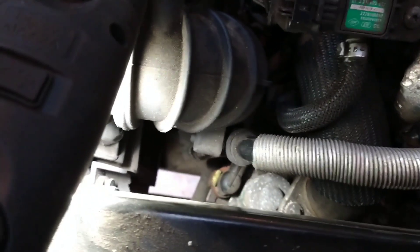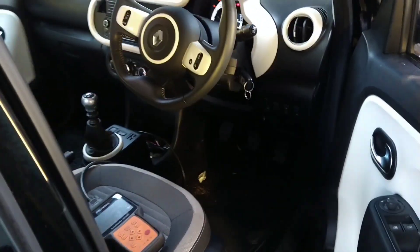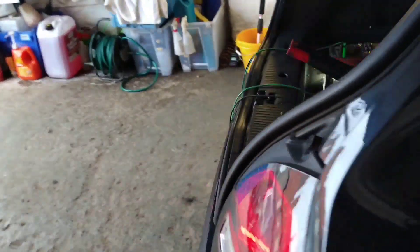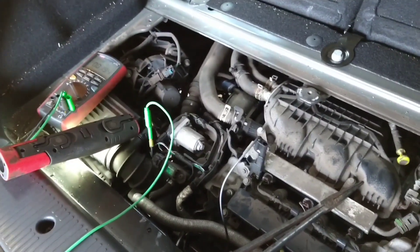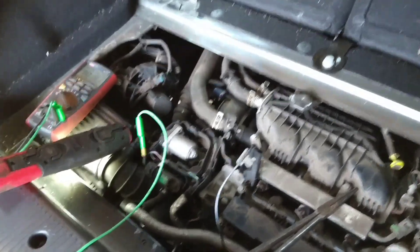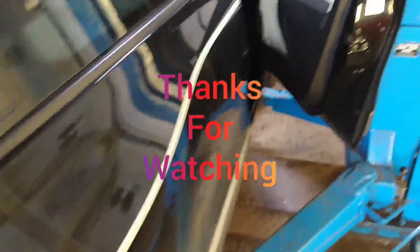Anyway, that's just to show you that when you get a fault code for an accelerator pedal, you can't just put a part on it — it's not going to fix it. You need to really look and see why it's faulty. In this case it's going to be the turbo. If it's unplugged, we're okay; plug it back in and it shorts out and brings down all the other sensors on that particular 5-volt supply. It's not all of them on 5 volts — it's half of them — but it pulls them all down. Thanks for watching.